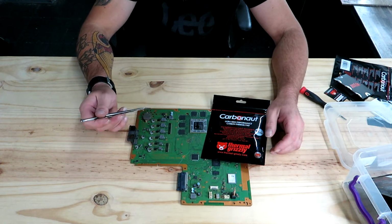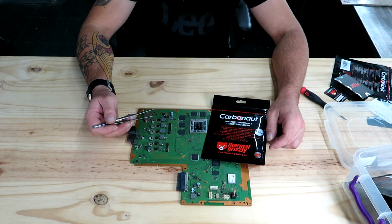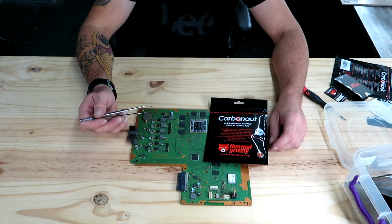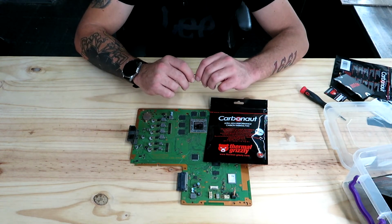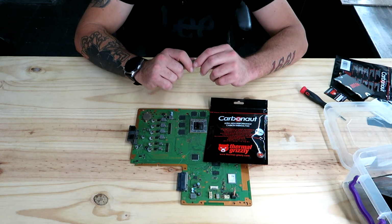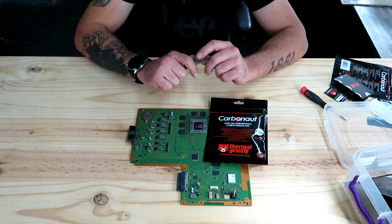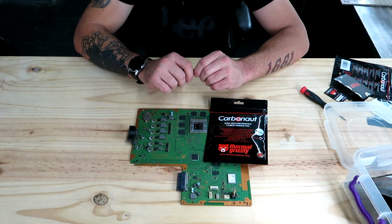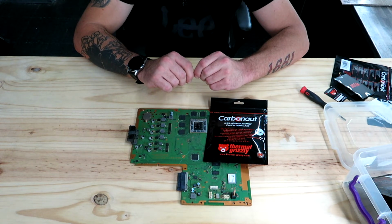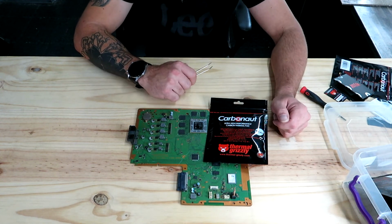We've been doing this for 10 years. We do gaming repairs here in South Africa, and I thought I'd share this with you guys today, because I can see a lot of our viewers and subscribers on our YouTube channel are battling with this major problem on the CUH70 and CUH71 Pro PS4 Pro models. They do overheat, and the fans pick up quite a lot. So don't use thermal paste, it doesn't work. On the PS4 Pros, just use these pads.